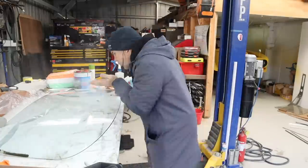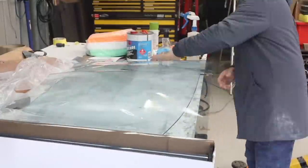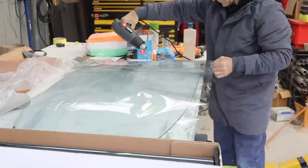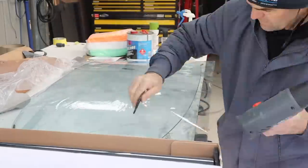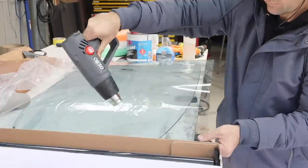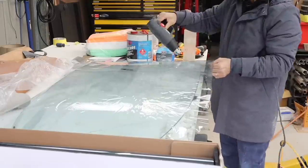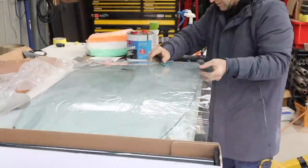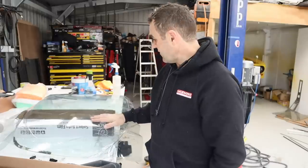So this technique, I'm blowing some baby powder over the window and then using a damp cloth to wipe an H in it, and basically trying to stick down the tint either end and in the middle so that I have all the wrinkles from top to bottom. And that's the way you should shrink them, is keep the ends straight and shrink in the middle. And I'm doing this dry, so this is called the dry method. And I'm going through and shrinking it here, and it's shrinking much, much faster, but I'm still struggling.